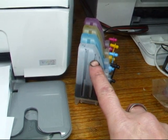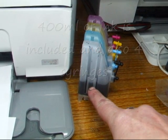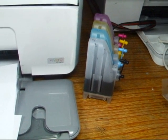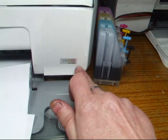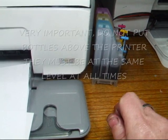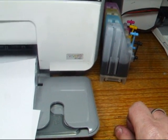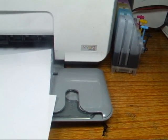You will need to put a bit more ink in there, but you get full instructions on how to do it. Don't ever let your ink go too low — about 15 to 20 ml up, you need to start topping up. There are full instructions on how to top up when you get the kit. One final thing: these bottles must be on the same level as the printer on the table. Do not lift them up higher than the printer and don't put them below — they're balanced to be on the same level. If you lift them up you're going to get ink everywhere and ruin your printer. So make sure they're on the same level. Any problems, the phone number's coming up. Thanks for watching.